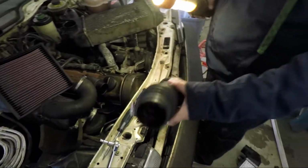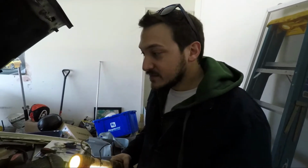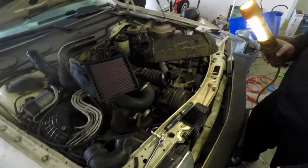After we did our initial introduction video, we were driving back, and I was looking into this, trying to figure out what it was, and I just put this in there, just for now. I did not tighten it down or anything like that, and it does have a worn out motor mount, so the engine just rocks crazy. Lots of flex. Then I lifted off the clutch real fast in third gear, and the engine rocked really hard and popped that boot off. We were literally one block away from my house, and the car just dies. Luckily we popped the hood, and I'm like, come on, please tell me it was that pipe, and lo and behold, the pipe was no longer connected to the throttle body. I put it back on and limped it home, and we're good. We started ripping it apart right after that, and that's where we ended up with it.